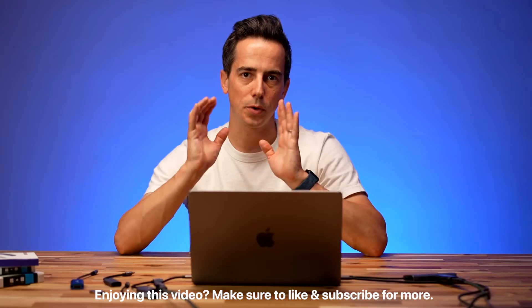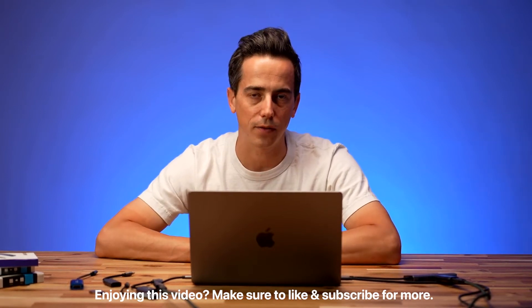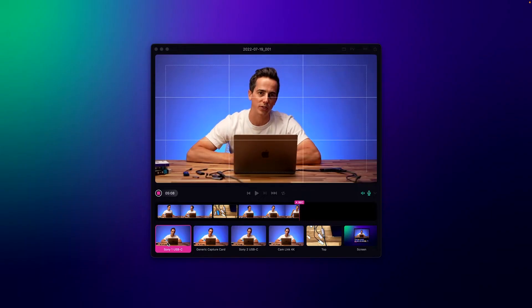First, image quality. What you're looking at currently is the USB-C output of the Sony — I'm using a Sony a7-4. It has a clean USB-C output which produces a stable 30 frames per second at full HD. The quality and colors over USB for this specific camera are really good. Sometimes when you connect a camera over USB the quality drops, there's a variable frame rate, and the colors are really compressed. But for this specific model, I think it's a very fair comparison.